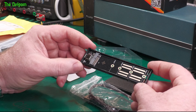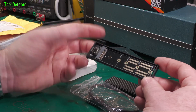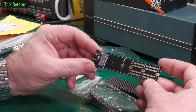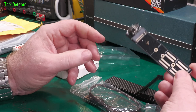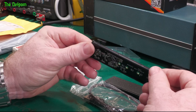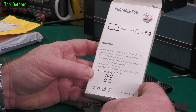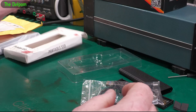I went to an external drive which I use for file storage and that's behaving better, but it's causing issues with backups because that drive is backed up and I don't need my cache backed up. So I thought I'd get an external drive case like this, put in a random SSD I've got laying around - 256 might be big enough, 512 certainly would - and just plug this in and use it as a scratch disk for video editing. It's supposed to do USB 3, 3.1 Gen 2. It supports M.2 NVMe. Comes with a little screwdriver too.